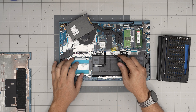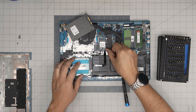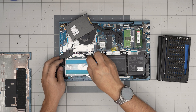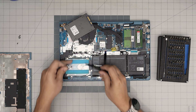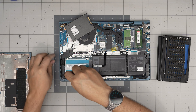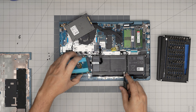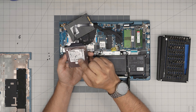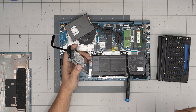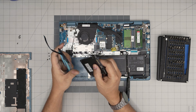First we're going to remove the mechanical drive. To remove it, lift up the latch 90 degrees upward, then pull the cable back at a 45-degree angle. Now remove the four screws on the caddy — the bracket that holds the hard drive in place. With the caddy off, you can put in a Toshiba or similar drive up to 2TB for a mechanical drive — low profile only, as higher-capacity drives are too thick. Any SSD up to 4TB will be low profile and fit fine.